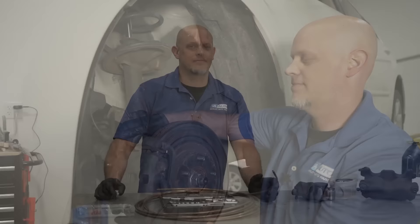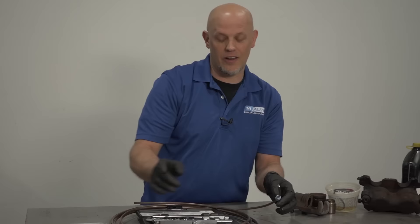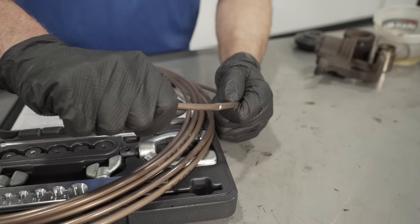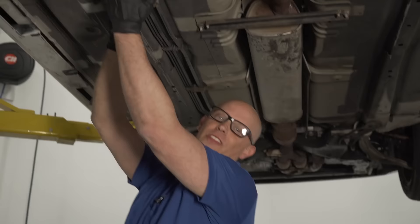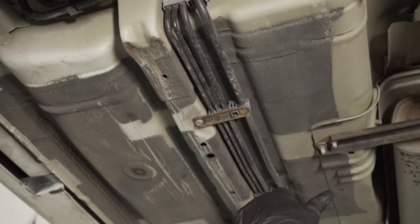When bending and making your own brake lines, make sure you put the fitting on first — a lot of times you get set up, make your flare, and then realize you forgot to put the fitting on. Make sure you use the correct fitting tool: there's bubble flare and double flare, and you never want to use a single flare on a brake line. When making your lines, make sure you don't kink the line while bending it — if you do, just cut it out and start fresh, because that part of the line is going to be compromised. Also make sure the lines are routed as close to factory as possible and not dragging or wire-tied to the exhaust or any moving components.